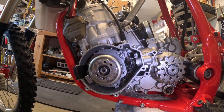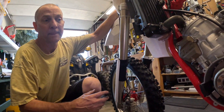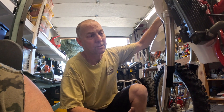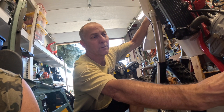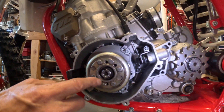There is one thing that's missing from this flywheel — there's a weight. It's not a counterweight, it's just a flywheel weight that makes the whole assembly heavier. On a motocross bike, would they take that off? More than likely yes. This particular ignition setup — the guy I bought it from said it was from a '97 250 EXC. I know they make that weight — it's actually part of this assembly. You can buy the flywheel with that on there, but it's like a couple hundred bucks. I'm not gonna buy a new one. What I did find is somebody selling just that weight — I'm gonna buy that. There's four M6 holes that just bolt that thing on. The cover fits without an issue.